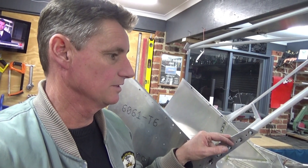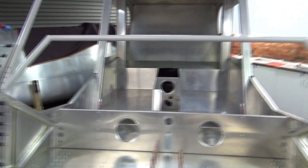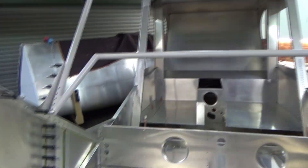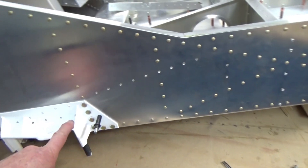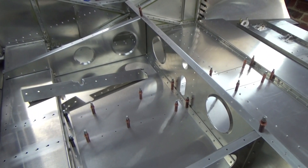The cage can still come off at this stage. It's also about time to look at painting the interior — I can take the powder-coated cabin frame off, spray the interior, and keep going on the other side. I've just got to rivet the weldment or landing gear bracket on this side and then we'll move on to installing the seats.